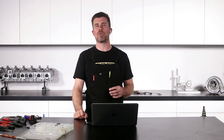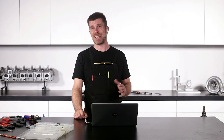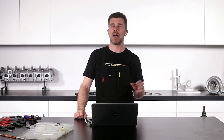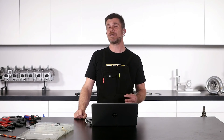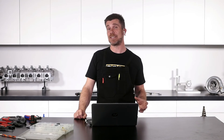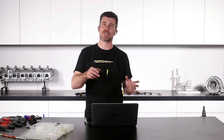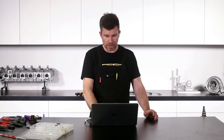You can get a little bit more involved and crimp and extend each wire individually, but that again brings in all of those crimp points which are potential failure points. A key one to consider is when you are extending some of the mission-critical sensors like the engine speed and position sensors — these will be run in a shielded braided cable. So you do need to run the extension in a shielded braid as well, and extend the shield from one side to the other, so that's important if you want the best reliability.